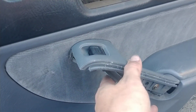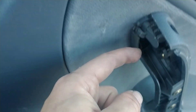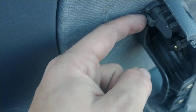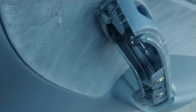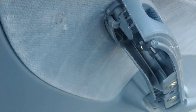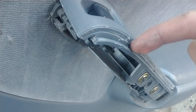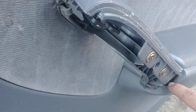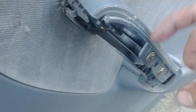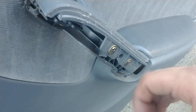Once that's off, come to the handle assembly. On this corner under here, you'll find a little hole and a clip inside of that hole. Push that in with a flathead screwdriver and pry this piece off. This one was kind of stuck, so I took a very thin flathead screwdriver or trim tool and went along this edge and pried it a little loose. Be careful — the bottom is a hook and has to be pulled out last. Loosen it, pop it, and remove it all as one piece.